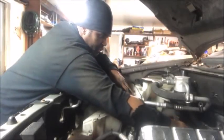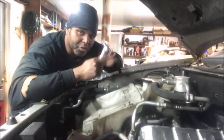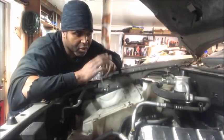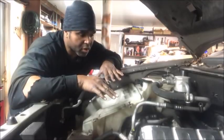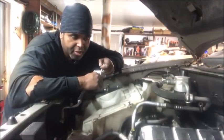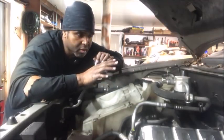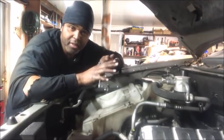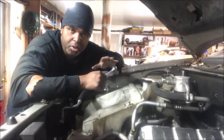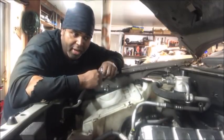What's up, my LS-crazed amigos, it's your boy Terry speaking from the garage shop, here to offer you some more big bang for the buck product and info. We're getting it in with this Trailblazer SS. What I did was just install the passenger side head and the headers. When you install the heads on an LS engine there are 15 bolts, and all the bolts have to be torqued in degree and in sequence. We're gonna discuss the torquing and degree-ing of the bolts, and also have a chat about installing aftermarket headers.